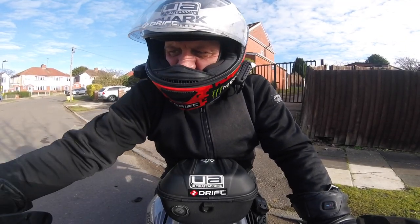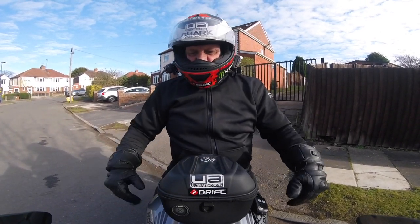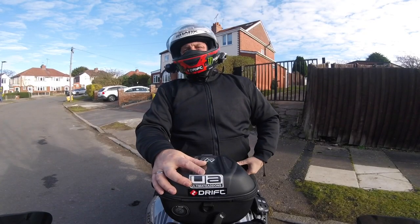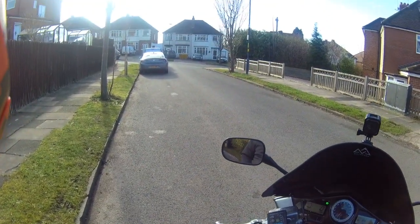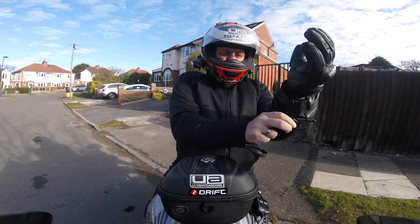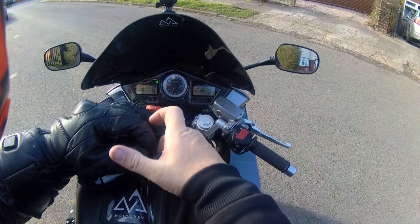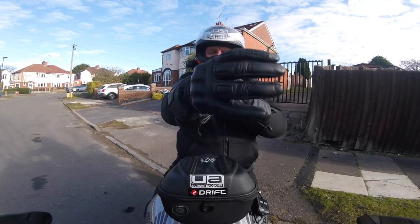I've gone for the full shebang - I've got the heated gloves on, the heated jacket on, heated trousers, and the heated socks. I've got everything. What I'm going to do first is go and do a few miles with it off. The left will have trousers and socks, the right will have the jacket. I never checked what fuse I've got installed - it's rated for 14.8 amps total, so I think I've got a 20 amp fuse. I need to swap that for the blue one, which is 15 amp, because I don't want to fry myself.